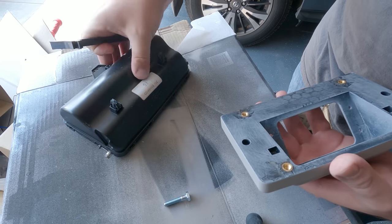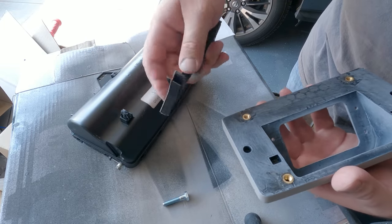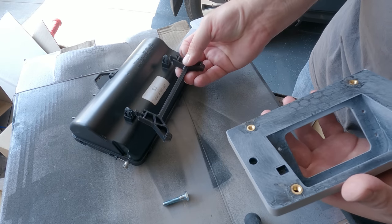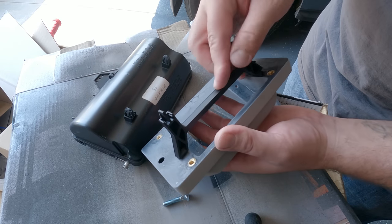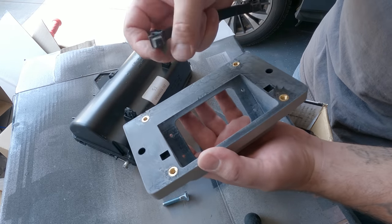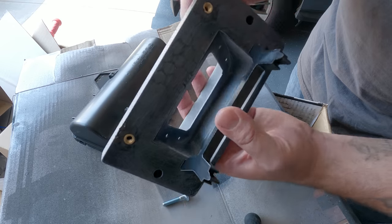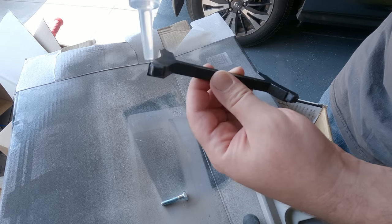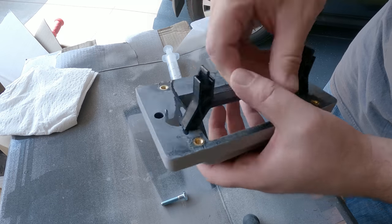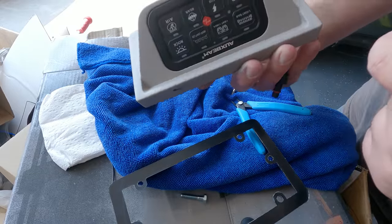The sunglass holder actually has these clips that hold up the whole trim, so I have to mimic that otherwise the front side will be dangling. I mimicked those two spots and created a bracket that attaches to the top. I'm going to use acetone to basically melt the two plastics together - it's both ABS so it should bond really well and make it one part piece.